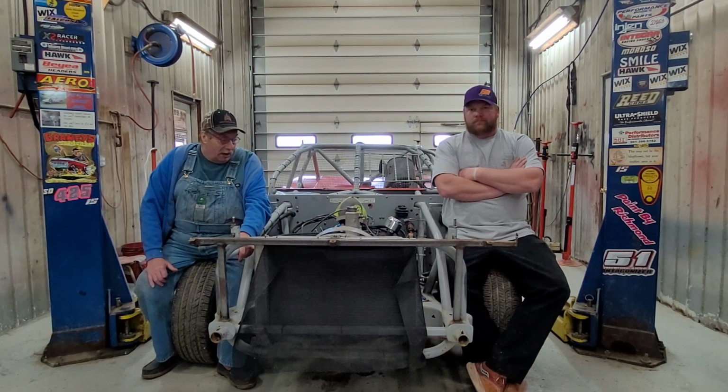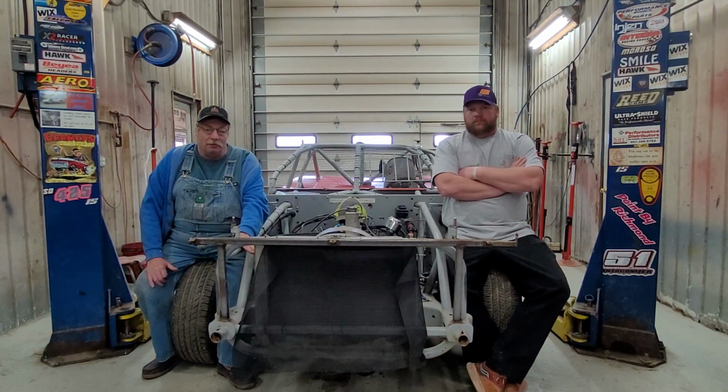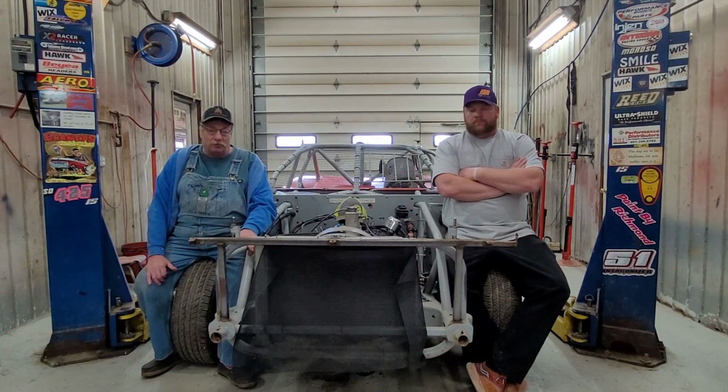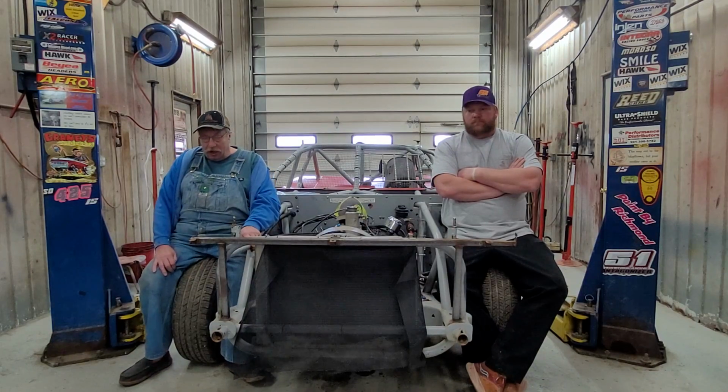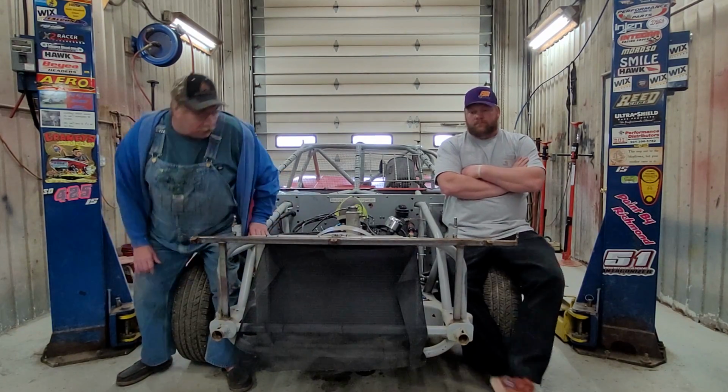So we're gonna just jump in. We just had to move the distributor a couple teeth because it was a little off. The motor has run this morning, so we're gonna play with that just a little bit. And we're just gonna keep rolling and get this done.